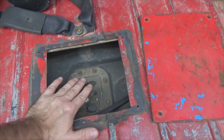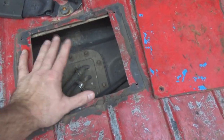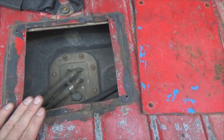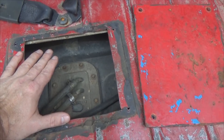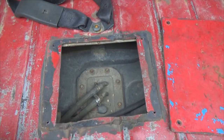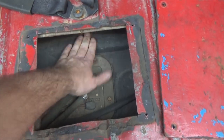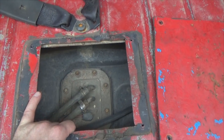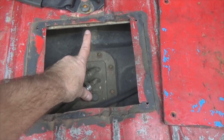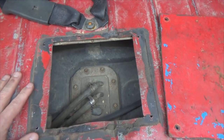Now here is the problem with doing this mod. Whenever I performed this mod, I had my gas tank out. I did the proper measurements from the tub edge in here and had reference points underneath the tub — the body — as to where I needed to cut my hole. Now here's the catch: if you do this with your tank in, especially stock Jeeps — see this big huge gap right here? That's because I've got a three-inch body lift the previous owner put on this thing. With no body lift, your tank's gonna be sitting right along in here. So if you cut too deep and cut into your tank, cutting is gonna have sparks — sparks and gasoline equals bomb.